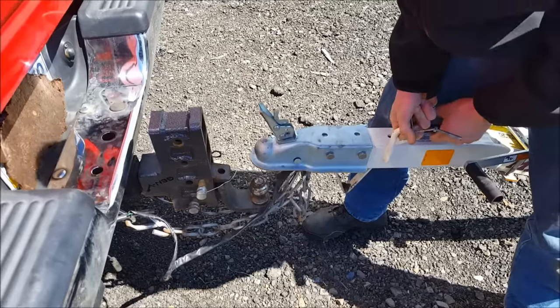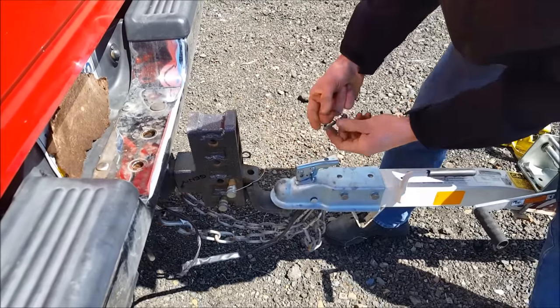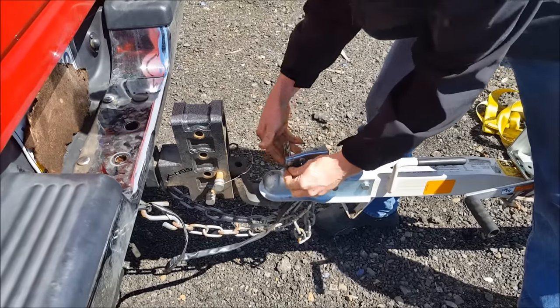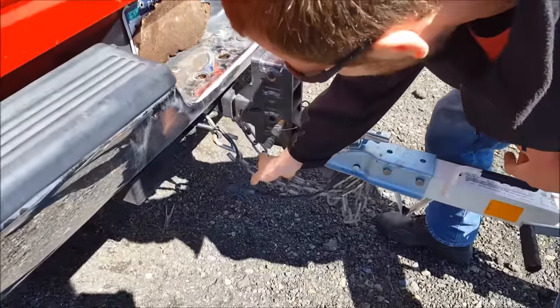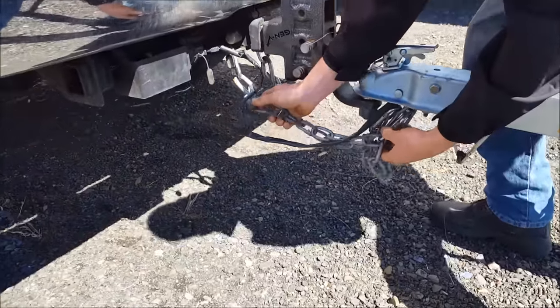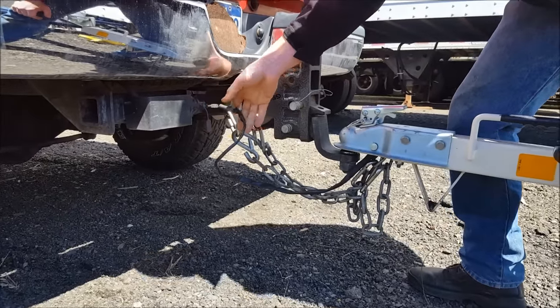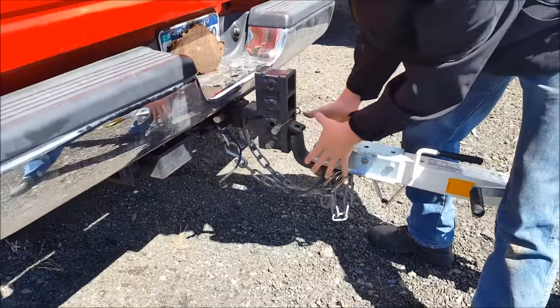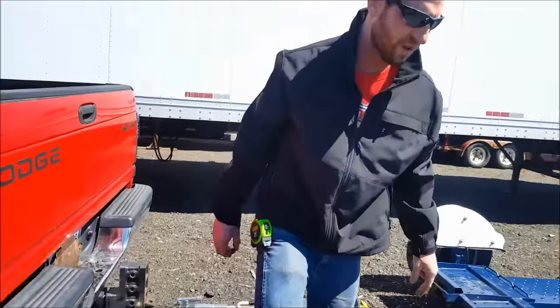You're going to start by throwing this on — this has a two-inch ball for this one. Lock this down and make sure you either have a lock or safety pin to put in here, because you don't want to rely on this little spring-loaded tab, cheap China. Then you're going to go ahead and cross your chains, make sure to lock those and cross those, and then hook your four-pin electrical connection up. Make sure your hitch is set at the right height because otherwise those ramps don't fold in and they're going to drag.